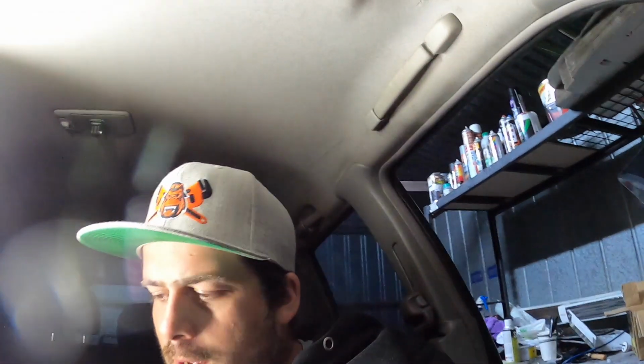I need to look back through the wiring and see what does the RPM. Alright, that's got me stumped. Maybe I need to put the cam one back on too, I'm not sure. I'm going to head inside and do a little bit more research, and also have a look on my wiring diagrams that I've got on the computer. So I obviously didn't print off all of them. We'll see if we can find what does the tacho. Already looked on the ones that I've got there. So there's two wires going in there, they go into the ECU. Obviously, there's an input that I'm missing.